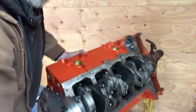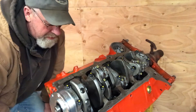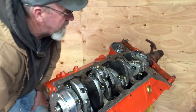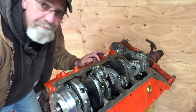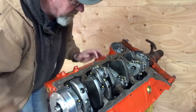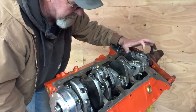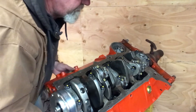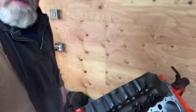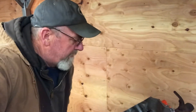It's a two-bolt main block, but two-bolt mains can handle it — beyond about this power level you'd want an aftermarket block anyway. This is what they call a high-nickel block. Since it's a stroker, they ground all the clearance for the rods on the journals. The machine shop also did some port work on the oil passages and some grinding around the block to help oil flow — he's done that on the last couple of blocks he built for me.